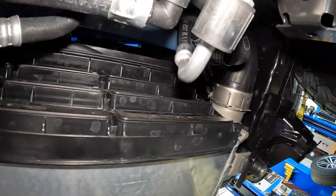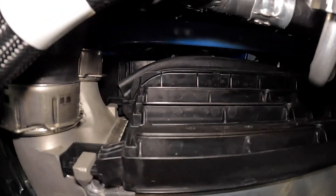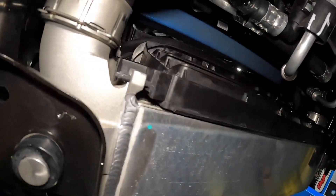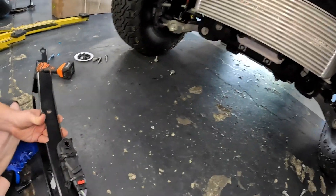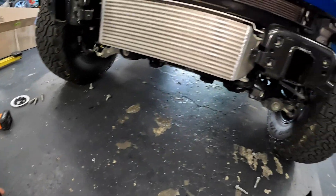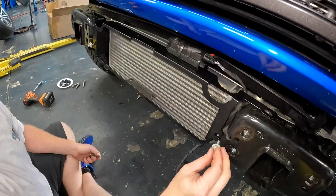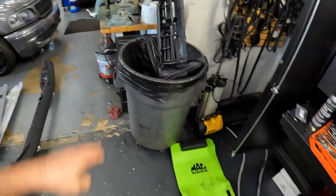Here it is with the shutters on the back — this directs airflow when the electric fans are on, pulling air through the intercooler core and creating a seal at the bottom of the radiator. It's kind of optional whether you want to run this or not. Given the way we drive and tow, I thought it'd be better to have it. If you just want wide open performance, you could probably leave it off. We pulled out the little actuator from the active grill shutters — we're not going to need those. Whipple gives you two zip ties to tie it up out of the way. We also left the bracket off the front so you can get more air directed directly into the intercooler core.